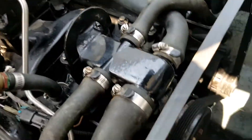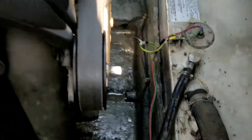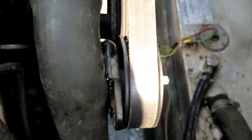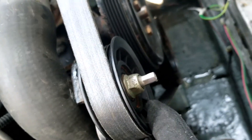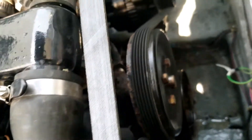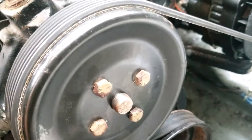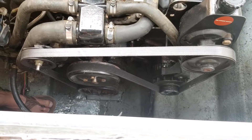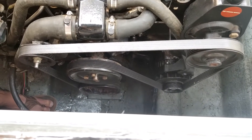On this particular motor there is a tensioner pulley, which is right here. There are like these little teeth. I'll loosen the tensioner pulley. I'm actually probably going to remove these bolts first, and this pulley you have to transfer over to the new water pump. Before you remove anything, you'll want to make sure and check how the serpentine belt is routed.